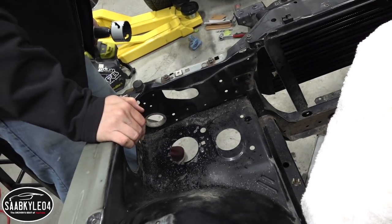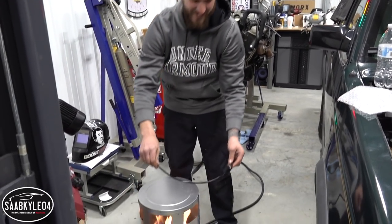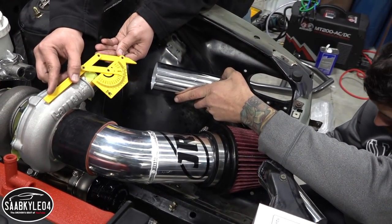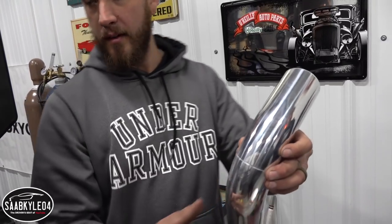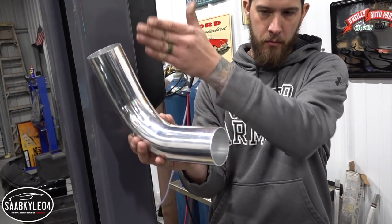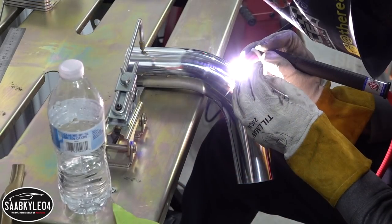One hole to cut. It's real malleable — don't try this at home, kids. So I took a 90, split the difference, made two 45s. Coming out of that fender well, I don't want just a straight 90-degree on one axis — I actually want to rotate it to get it to point towards the intercooler for a nice smooth transition. We want to do the least amount of couplers we can on this build. I'm going to get that other pipe, put it back in position, start marking stuff up, start tacking this together, and hopefully have a hot side pipe in about a few minutes.